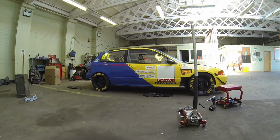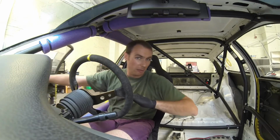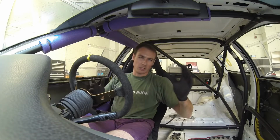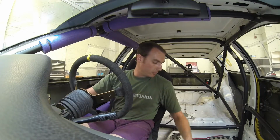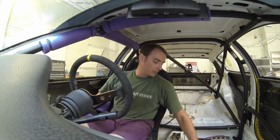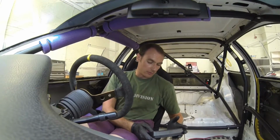Right, that's the car levelled out again, with this side about 3mm higher than that side. Thing is, we're going to be adjusting the height here and there anyway, so 1mm isn't going to make much difference. So let's put it on the scales and see where we're at. So turn the scales on. They're zero anyway, but we'll zero them just to make sure.